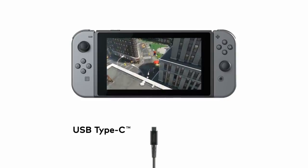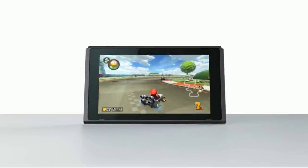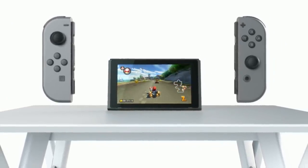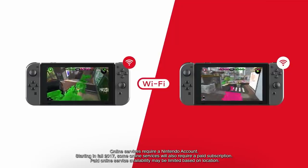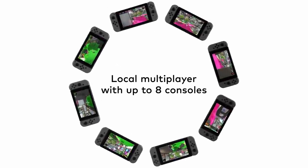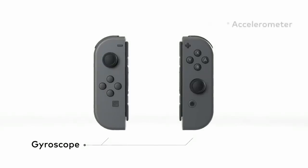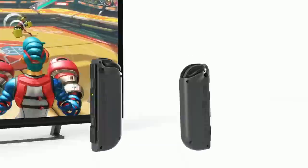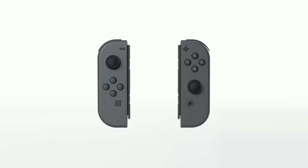What they're saying is: if you let your Switch collect dust for seven months, the battery might be completely toast. Interestingly, I can still pick up my old DS, plug it in, charge it, and it'll hold a charge — not like it did in its heyday, but it holds a charge. This warning I've never seen from any company. With rechargeable batteries, yes there's degradation — keeping a lithium-ion battery at full charge constantly, like leaving your Switch in the dock, will degrade it some, but it'll still hold a charge and degrades much slower when discharged.